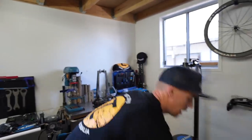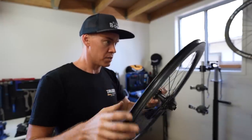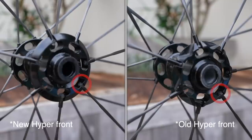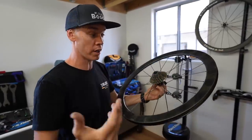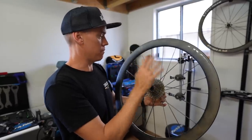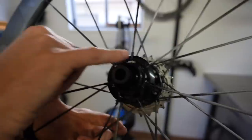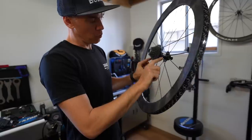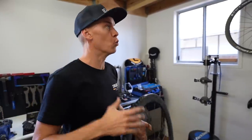From a wheel-building perspective, when a spoke is touching you do get shoulder support, so you can run a different blade of spokes. They've done two design differences here: they've changed the hub nut where the spoke comes into the hub. With a normal cylindrical-style spoke, they can just turn freely, so when people are doing wheel trues or tensioning spokes, the spokes can actually move and change your spoke tension. The new wheels have flats machined into the top of their hub nut to stop that from twisting — probably done to stop noise.